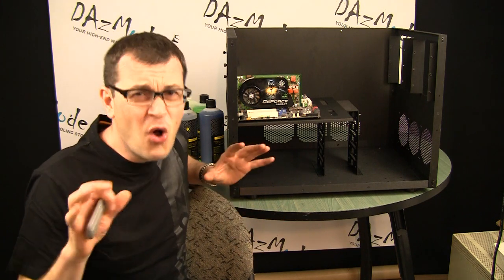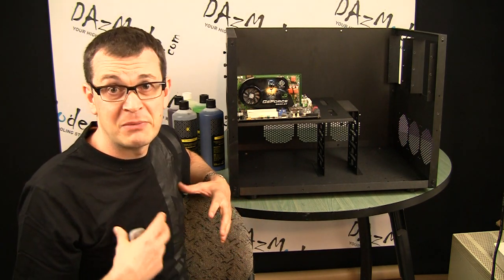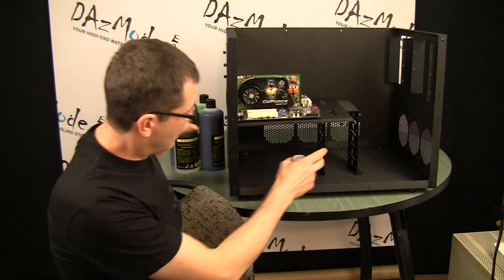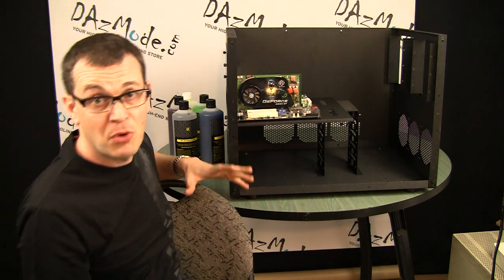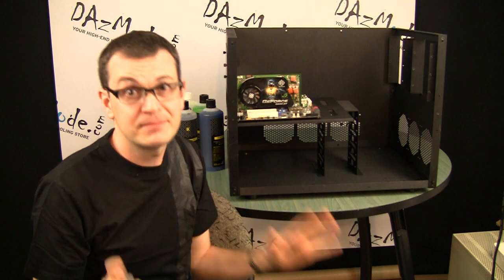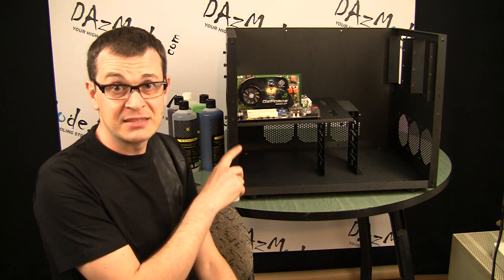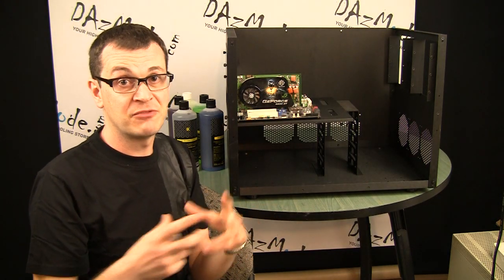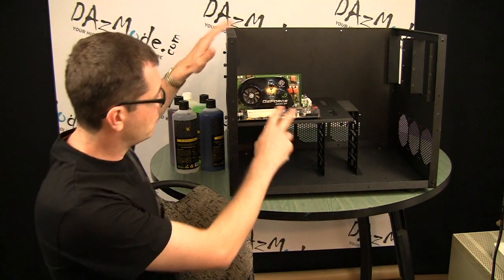Some of you made comments that the case is horrible, nothing works, bad reviews, this doesn't fit, that doesn't fit — so you made me scared. What I did was actually assemble more: I put the tray in and checked that everything fits. I actually put a dead motherboard with a graphics card to see if there are any problems before I paint, so if I need to do some metal work, I'm covered before the paint job. Everything fits fine, I have no issues. I can see they actually made bigger holes in one place — that was apparently a defective part where something would misalign — but right now everything works. I have the motherboard installed, no problem, graphics card, everything on the back is fine.